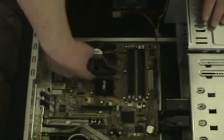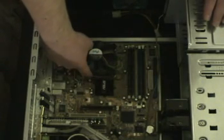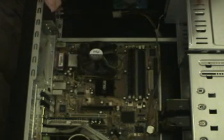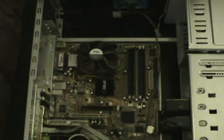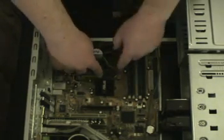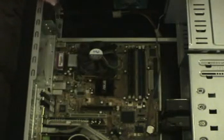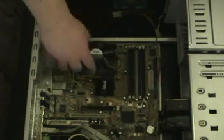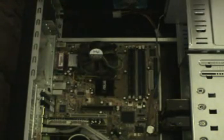This happens to be a stock heat sink, but as you can tell, the distance between the Northbridge and the CPU is incredibly small — just enough to fit two wires, not even three. So when you're buying an aftermarket heat sink, you have to do the measurements yourself and make sure the stuff is going to fit. Also, the CPU cooler blowing down blows heat across through the grooves, actually cooling the Northbridge using the CPU cooler. Most people don't look at that. If you get one of the ones that stands up and blows sideways, you no longer have that airflow planned for the Northbridge, so you have to add a fan.